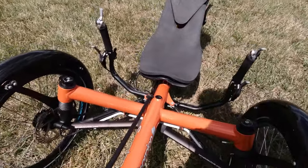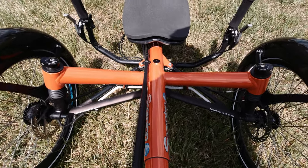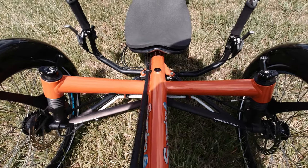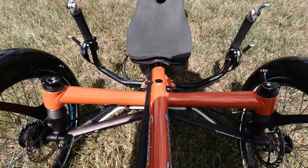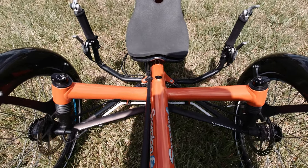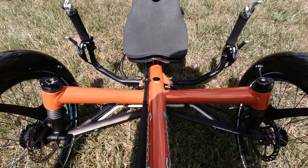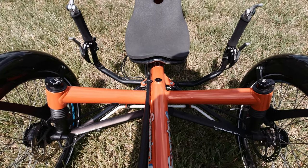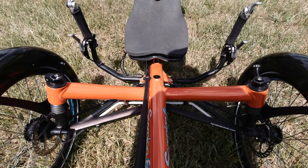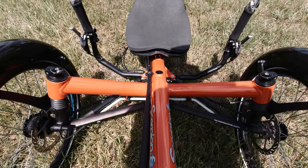One great thing about the HP trikes that I really like is the suspension, including their anti-sway bar and anti-roll bar — it's a very sophisticated suspension. The Germans are pretty sharp on their engineering. The suspension has two McPherson struts, and this trike has 2.4 inches of travel. In comparison, the Ice FS-26 that I just sold, with its elastomer suspension in the front, only had 1.5 inches of travel. The Azub Tie Fly, which is another very nice trike with a titanium transverse spring system in the front, also only has 1.5 inches of travel. So this ought to be a pretty nice ride up front.